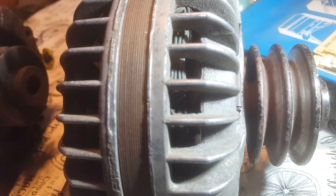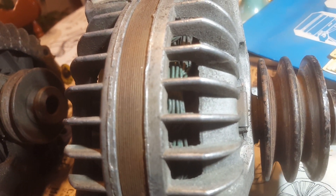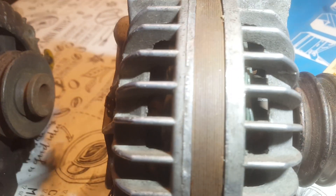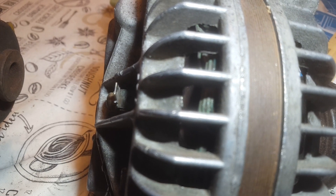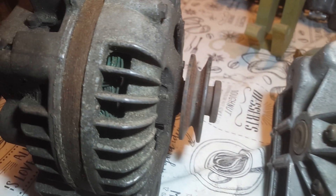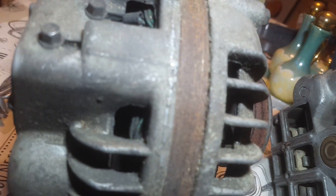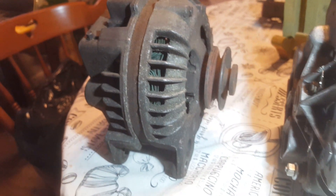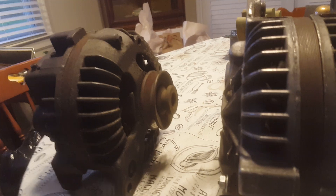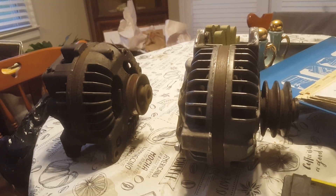As final confirmation of this grift, you look in here at the stator color — it's kind of washed out, but it's a green color. That green stator is visible in the 50 amp unit. And then you come over to this one — it's the 34 amp alternator — and it's also got a green stator in it. I'm sure this thing is original, and if somebody cares to challenge me on it, I can prove it.